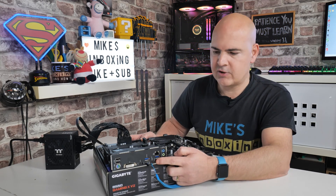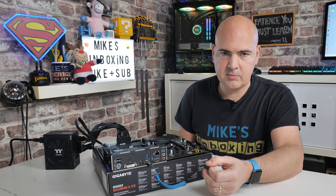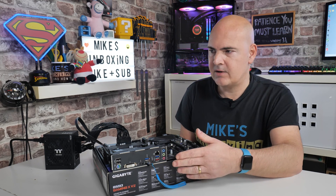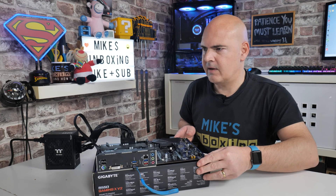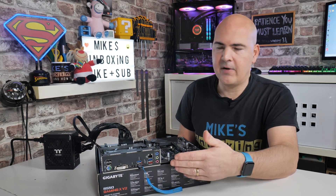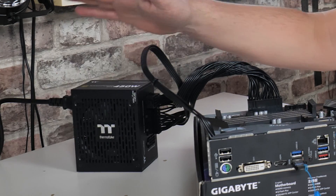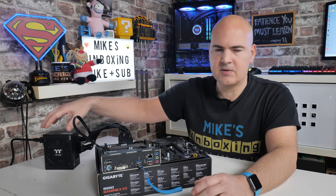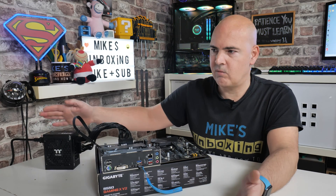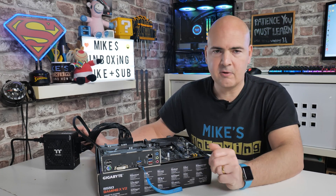Immediately you should see a flashing LED — this is the status LED. What we're looking for is for it to start flashing, then at about a third of the way through it will change flashing speed. There will be a couple of different speeds — it will flash, then speed up, then slow down. At the very end we're looking for that light to completely extinguish and turn off. The entire process should take about six minutes. If it hasn't changed speed after about two minutes, it's probably not going to work. If it flashes a couple of times and stops, it cannot read the file or the USB stick — go back a couple of steps and start over.